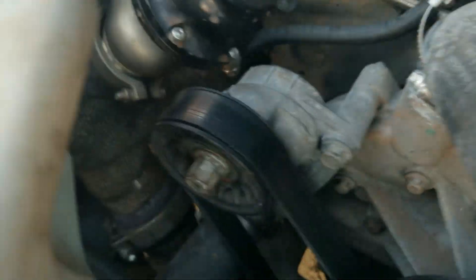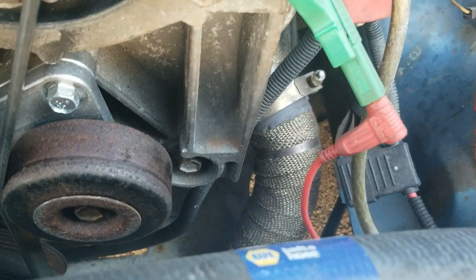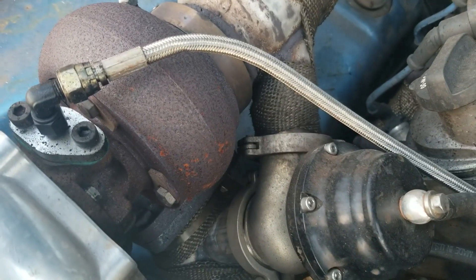Same thing on this side — the other factory manifold turned backwards. Plenty of space there. Got some nice elbows here. I want to say this is 2.5-inch pipe — it's either 2.5 or 2.25. Cheap blow-off valve recirculated into the 4-inch downpipe.